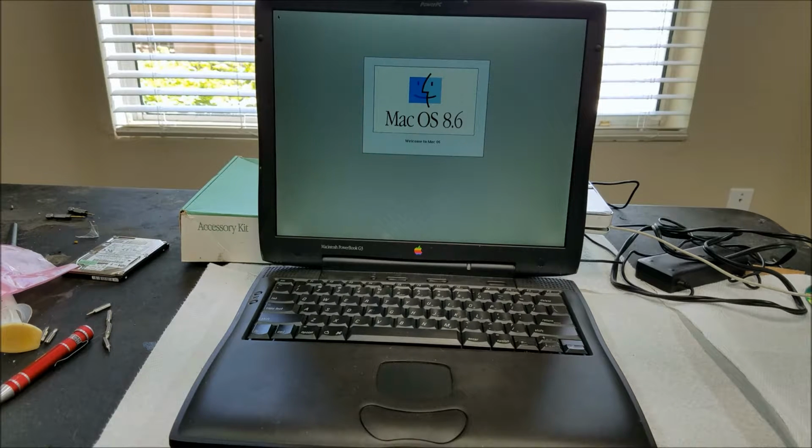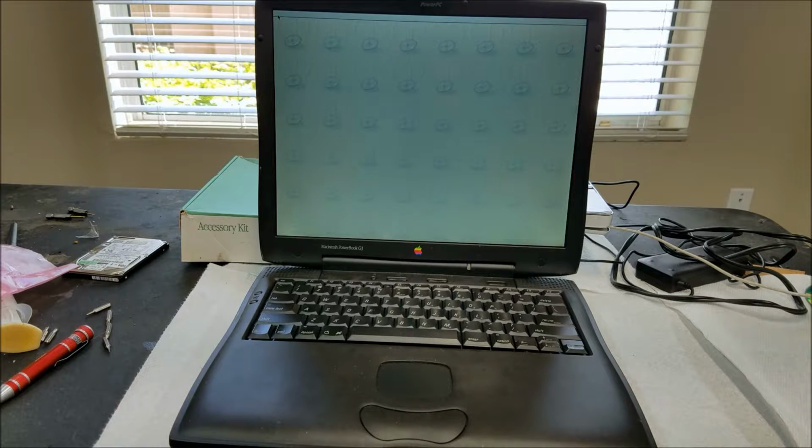I haven't really decided what I want to use this machine for, but probably one thing I can use it for is, because it has, I think, the SuperDrive floppy drive, I can write the 400 and 800K floppies for the older style Macs from this, which you can't write on the PC. Before, I was using my PowerBook G3 Beige for that. It works pretty well. The only problem is that for some reason the Zip disk on that one sometimes won't eject, and you have to restart in order to get it to eject the disk.